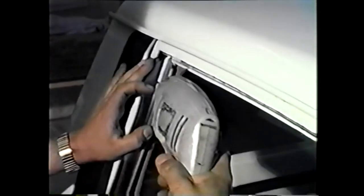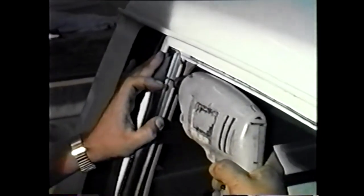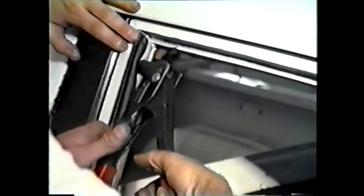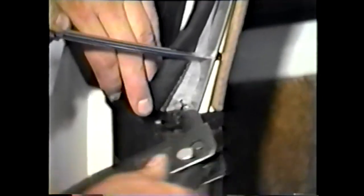Next, we will be installing the aluminum window frame supplied with your kit. Starting at the top, drill a hole with a one-eighth inch drill bit through the original window frame. Using a one-eighth rivet supplied, rivet into position. Next, using clamps, draw in the bottom portion to fit the curvature of the roof and rivet in position as necessary. Be sure to shim and make adjustments for your particular fit. Roll the window up and check the positioning before permanently attaching. Use a screwdriver to push in the bottom while installing the rivet.